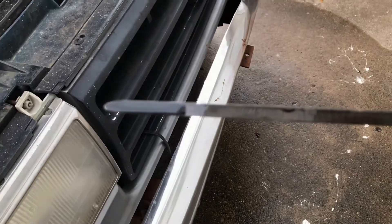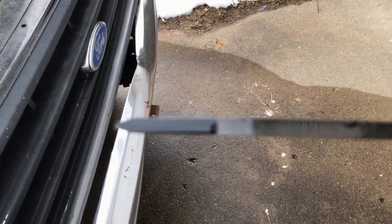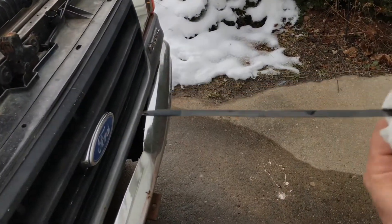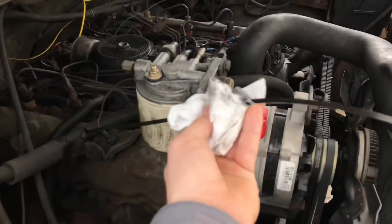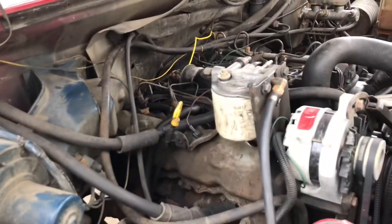So I'm going to check it again here and get on the road. We have another problem to figure out and dissect — another annoying issue. Let me pop the hood and check things out. Six quarts got it to about halfway up the hash mark — you've got your hash and your full. So she was just about empty. Yeah, that's crazy it didn't lock up. We're gonna fire it up — it's been sitting since last night — and do a little cold start to see if it has any weird noises.